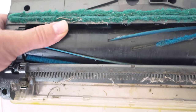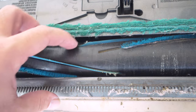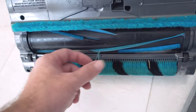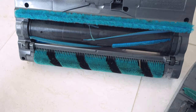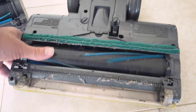Another interesting thing after this much use is these little flaps. If you look carefully they're very small — I don't think they were that small before. Over time they got shaved off, and you can see a really flat line where it's supposed to be curved. Comparing it to the newer head, the flap is much larger — this one on the old head is a tiny little thing. So these little flaps are consumable over time, which is a bit unfortunate. There's a woven fabric on one side and a rubber on the other, and eventually that rubs off. But if you look, we have no hair anywhere — one thing these Vertex heads do very well is they don't tangle any hair at all, which is very impressive. Even though the design may not be perfect for the long haul, it does what it advertises — being tangle-free.